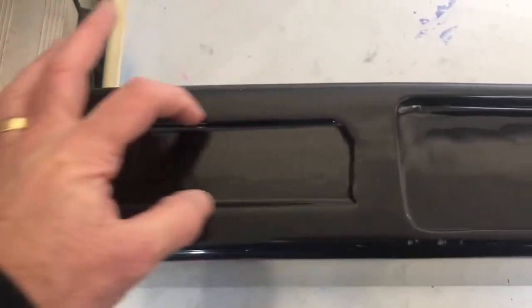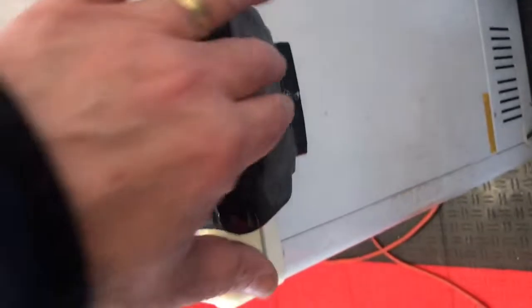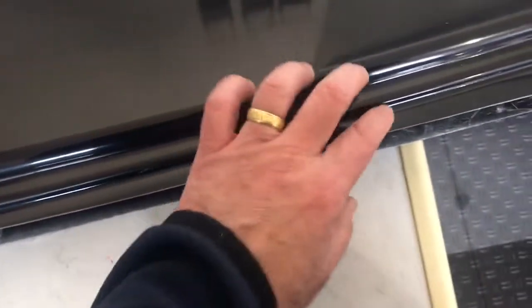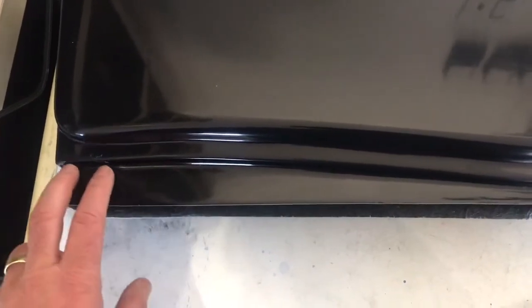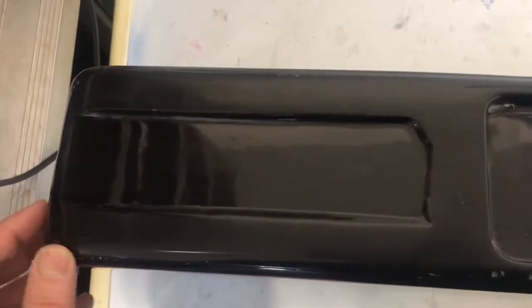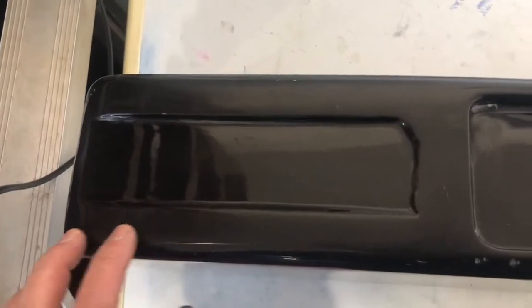In this video we've got a bit of cutting to do. This area we have to cut out to clear the front center frame member. We have to cut out the tail of this thing to fit into the interior tub, and the bottom we have to cut along this line so the bottom ridge sits on top of the center tub portion. I'm going to use some masking tape, a Dremel cutting wheel, and my favorite tool - the Christmas tree bit - just to get the corners done.